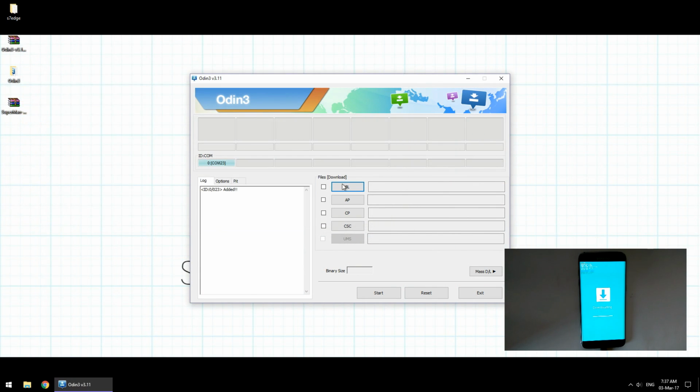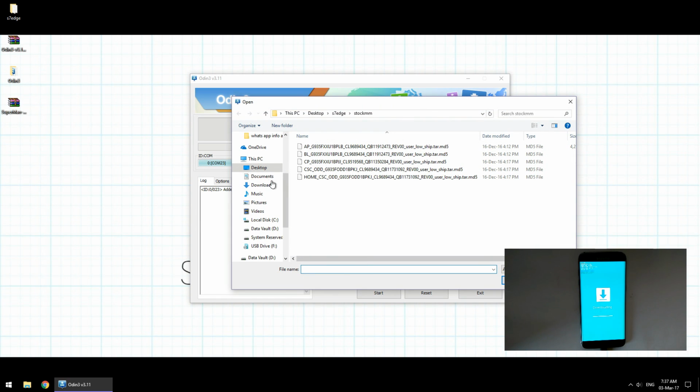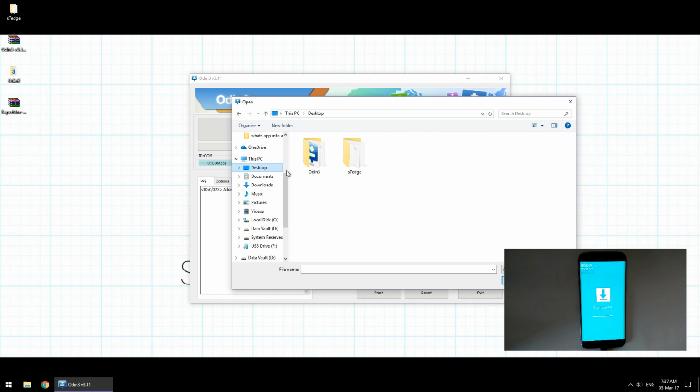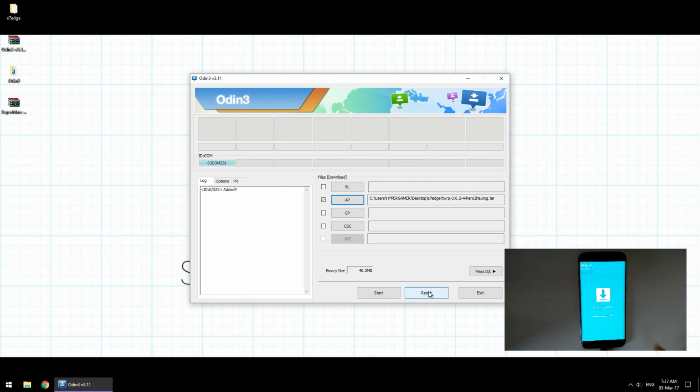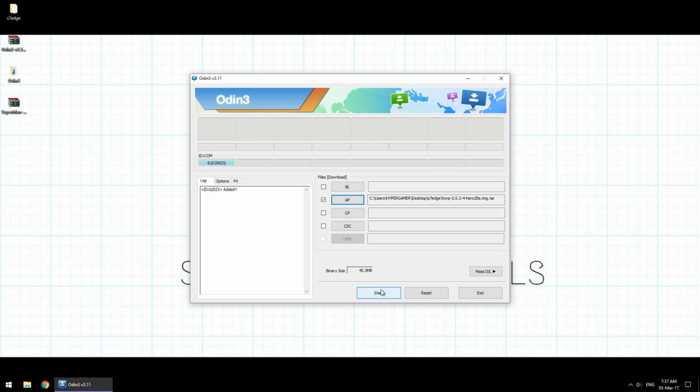Next up, you just need to go ahead and open Odin and click on the AP option and select the TWRP image that we've downloaded. The links are mentioned in the description. Now, very important here, you need to go to options and disable auto reboot. There you go. The recovery has been flashed as soon as you click on start.